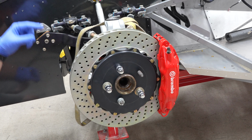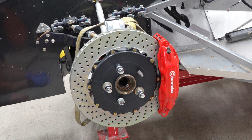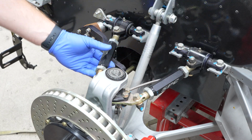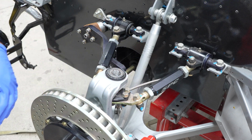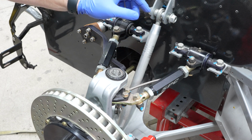And then all of like the suspension bits, like the upper and lower control arms, things like that, are off of, I think, an '05 Corvette. So it's almost all GM stuff, which is my preference in the aftermarket. So the design is a GM design, but this is an aftermarket upper control arm that are really adjustable, made by SPC, but the spindle is stock aluminum GM stuff. You'll notice the coilover isn't installed yet. I do have them.